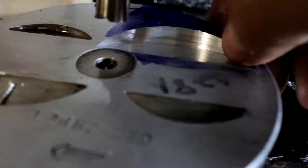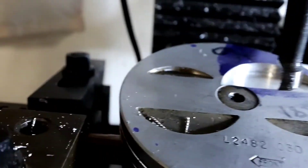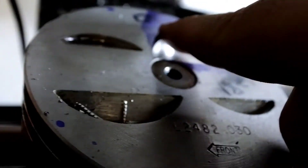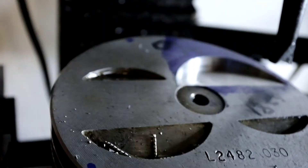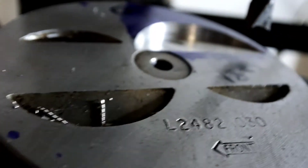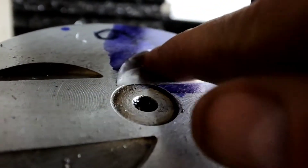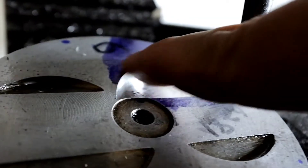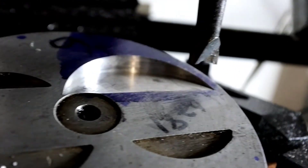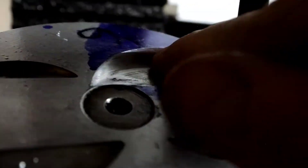The finish — I'm happy with the finish. A little bit of chatter on the back wall, but that's cool. I'm going to clean it up by hand and just knock those edges down. The reason you want those sharp edges out is because the thinner the metal is, the more it's prone to creating a hot spot. What that means is, if you have a 900-degree combustion event, it's a lot easier for that heat to melt or retain in that spot, because on the corner of the material there's less density, and it'll retain heat. So knocking it all down reduces that.